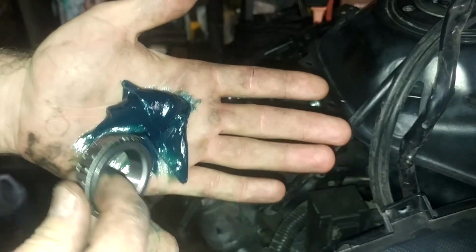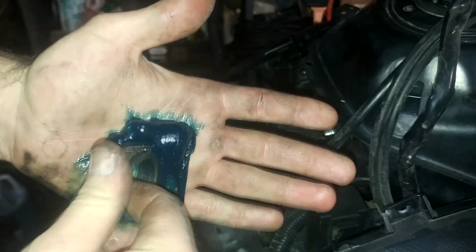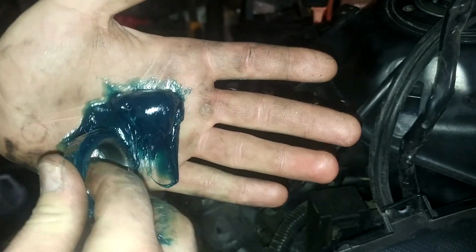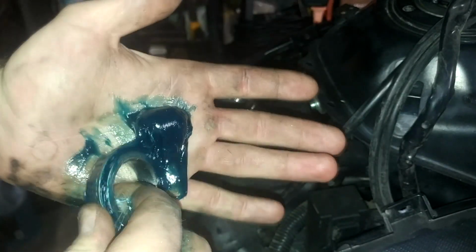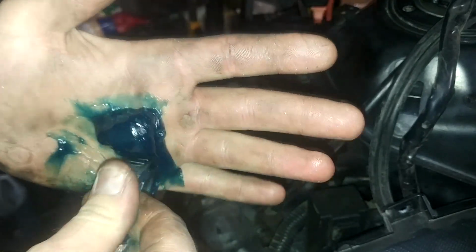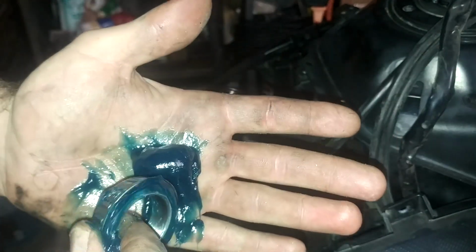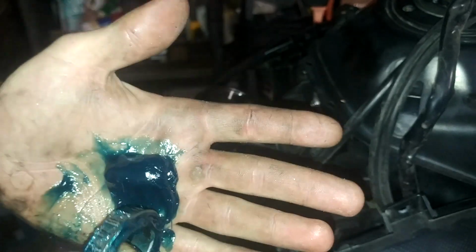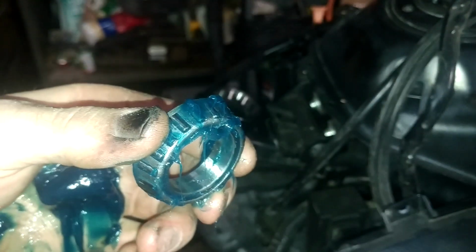I'm going to go ahead and pack these bearings. So I'm using the All Balls conversion top bearing, and then on the bottom I'm just using the OEM R6 bearing, which technically isn't the same OEM R6 bearing anymore. It's the same as it, but I got a kit from a used bike because I needed the crown nuts, I think they're called, the top ones that tighten the stem. I got that from a Yamaha R1, and they use the same stuff, so that's what I'll be using on the bottom. I'll do the same to the bottom and put them in there.